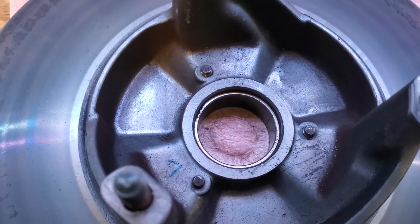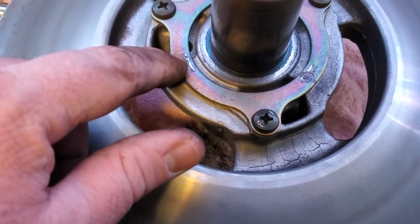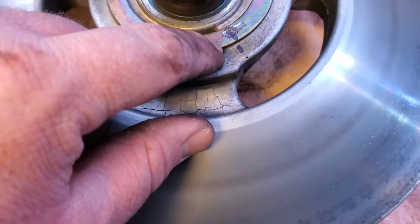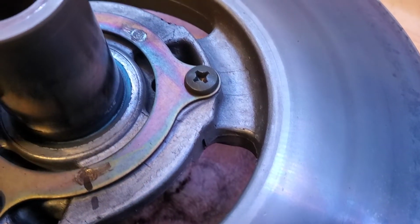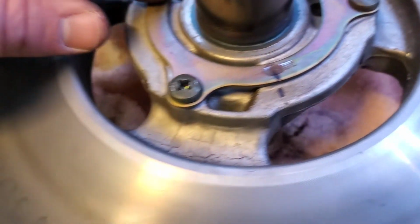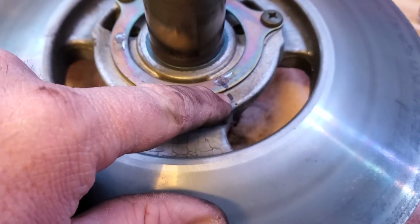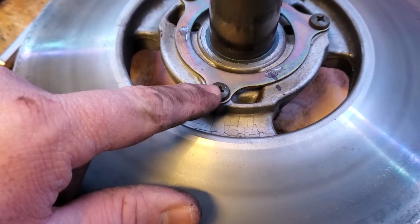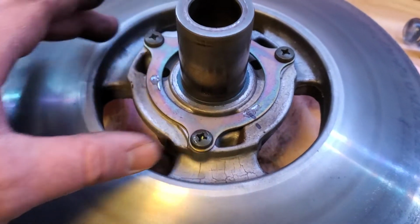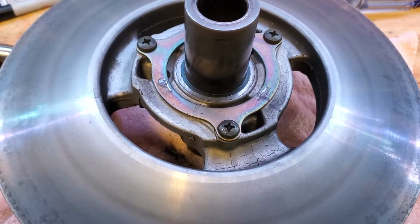And there you can see the back side of those bolts, the adjustment bolts. So when I flip this over, here you can see the spot that those bolts land every single time. And those holes, it's hard to tell on the camera, but those holes from being beat on all those years and rubbed on have just about close to a 1/2 millimeter or a little shy of that recess. So what we're going to do, I've already marked where it's at right here. We're going to go ahead and take this off, and we're going to look at a couple of options, possibly spinning it, one set of holes, which I don't think is going to work, or we're going to flip this thing over and wear the back side of it.